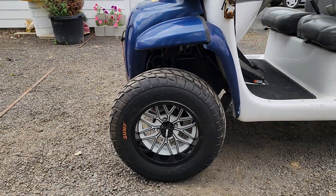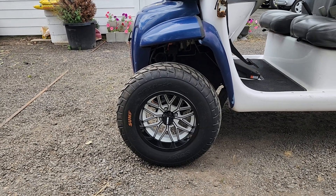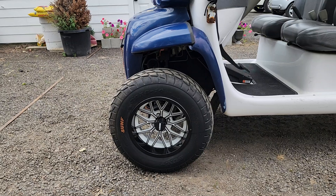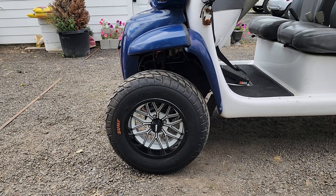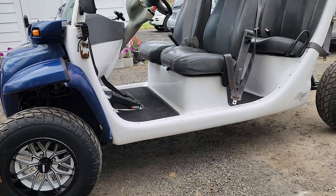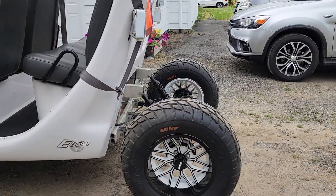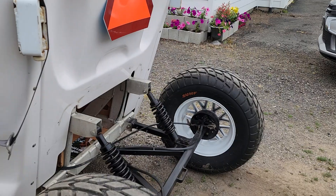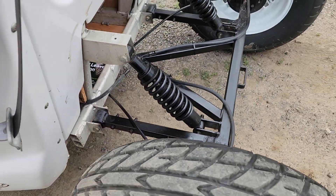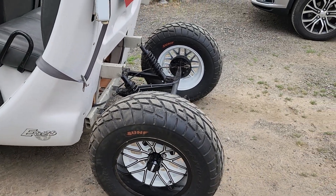As far as the lift goes, I've got a lot of clearance on top of the wheel. I really didn't need to lift the car at all — I only needed to move the suspension forward at least two inches to clear the wheels. In the back, I did nothing but took off the old bolt-on fender mounts and put these wheels on. Everything else is factory.